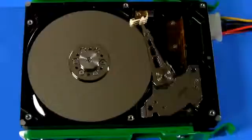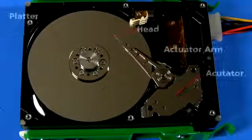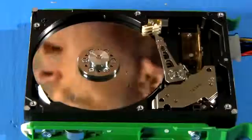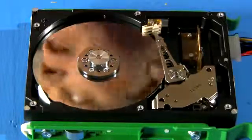Now, I'm sure you know the essence of a hard drive. We store data on it in binary form, ones and zeros. Now, this arm supports a head, which is an electromagnet that scans over the disk and either writes data by changing the magnetization of specific sections on the platter, or it just reads the data by measuring the magnetic polarization. Now, in principle, pretty simple, but in practice, a lot of hardcore engineering.